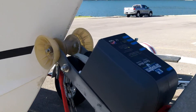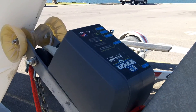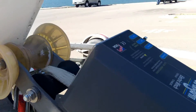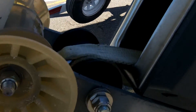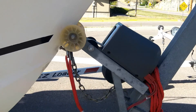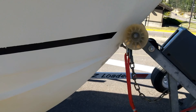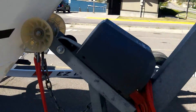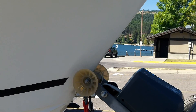Another important consideration is the winch. After a few trial and errors, this strong arm winch made by the same people who make hand winches turned out to be the best solution. It is a strap winch, meaning it does not use cable. It is important not to use cable — because of the load of the boat, when you're cranking it onto the trailer, the cable will cut down into the wraps on the drum and bind, and you will be stuck with almost no solution to unload or load. So forego cable winches and use a strap winch.